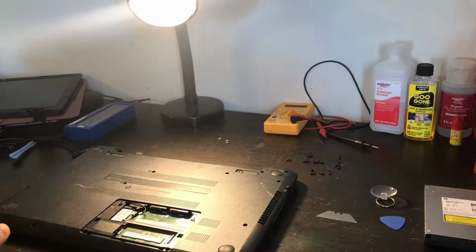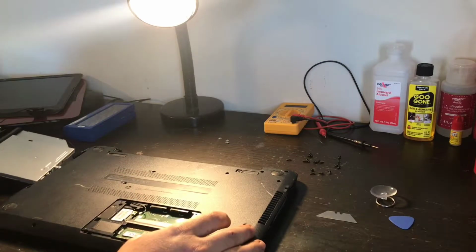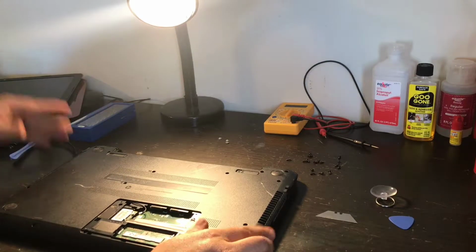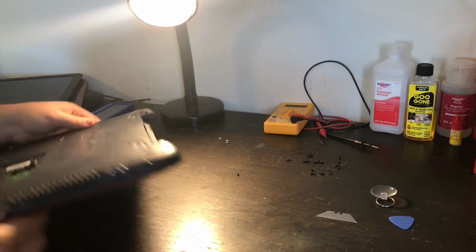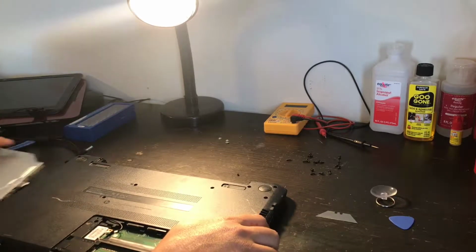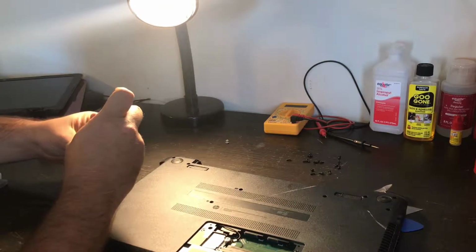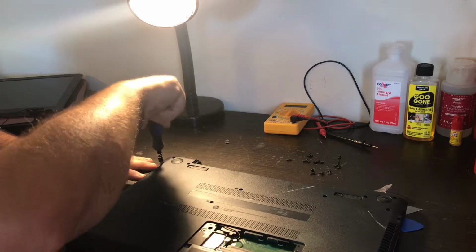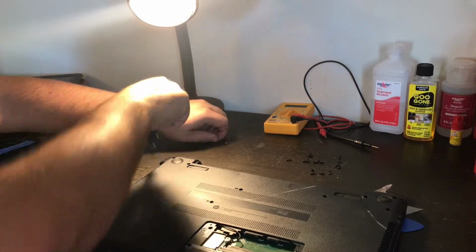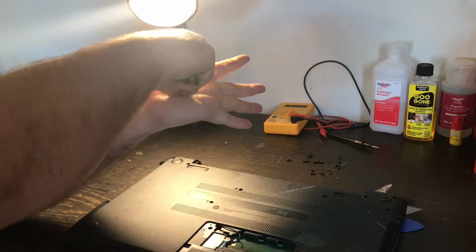Go. They are cooking with fire. Okay. And then we put the optical drive back in. And that's going to line back up when I use these screws. Wait. Almost forgot something. Before you put the optical drive back in, remember these three small screws? Well, these secure the chassis the rest of the way. So there's going to be three of those. Short, little, flat screws. See, they're very small, very small. Small thread, big head.